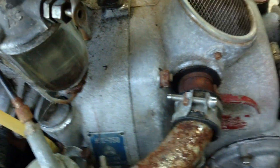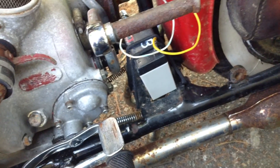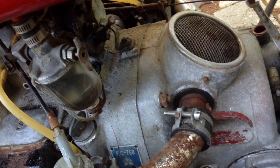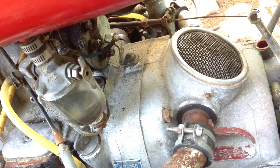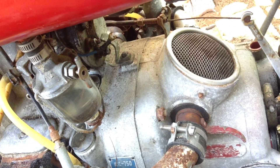Put the wires back on and we're all set. The battery charging voltage with my regulator was 7.2 volts at the battery at idle. With the field grounded, at idle it was producing 10 to 14 volts, and giving it a little gas it went over 20 volts. I'd say those are some fair figures.